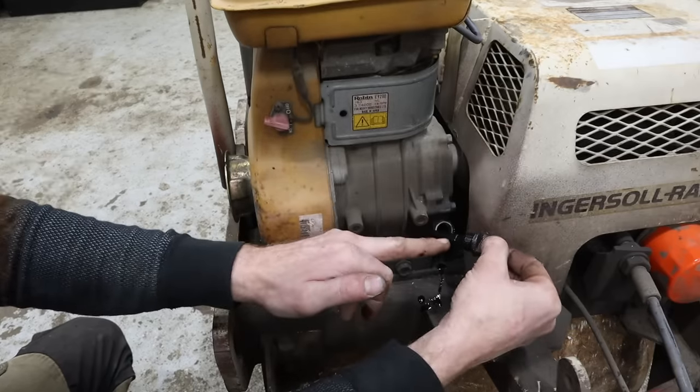That's our number. So I'm looking this thing over, looking for where the oil's leaking, and I might have found it. Right above the hydraulic oil filter is this fitting. I don't know, what do you think? I don't think it should be like that. Maybe just a tad bit tighter. Best case, it's just loose. Worst case, it's stripped out. Either way, we could put a helicoil in it if it is bad. I'm going to take this line off, thread this in tighter, and then hopefully still be able to get this on. We'll find out, I guess.